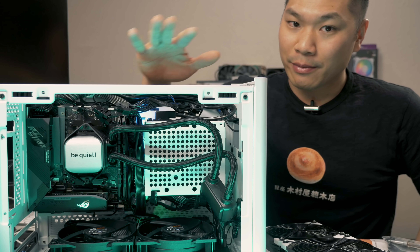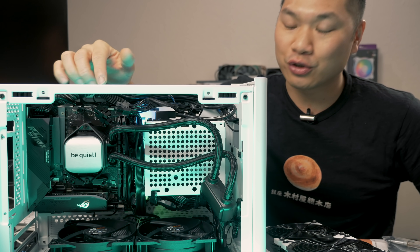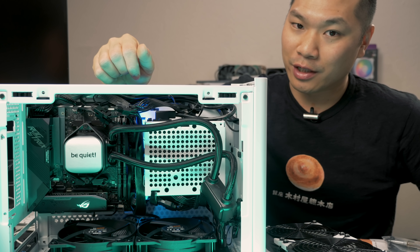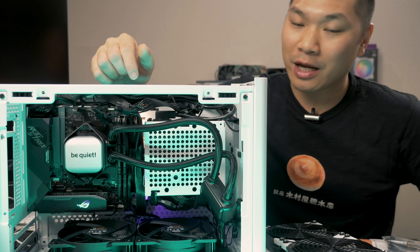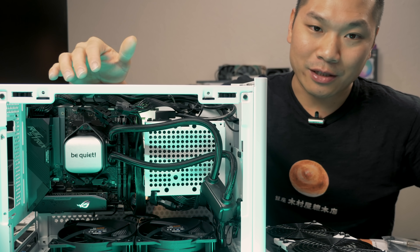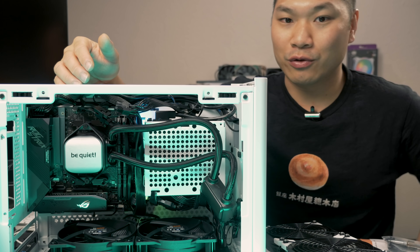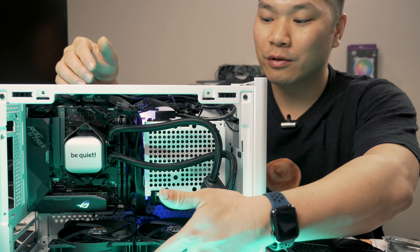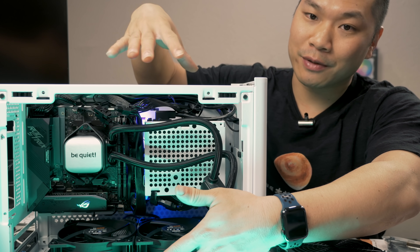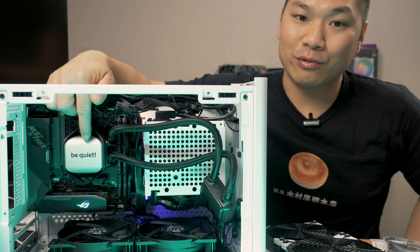With the unit installed, I'll explain why this design is ideal for bottom mounting. Due to the closed-loop nature of AIO coolers, it's very difficult to fill an AIO all the way, and the manufacturer also has to leave some room for thermal expansion of liquid. So inevitably there's going to be some air in the unit, and when there's air, it's going to migrate to the highest point in the loop. Normally air migrates to the radiator — which is fine if it's on top — but if you bottom mount that radiator, it's going to collect in the CPU block instead.